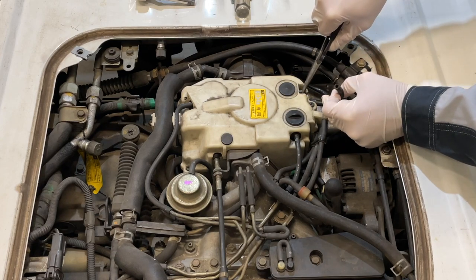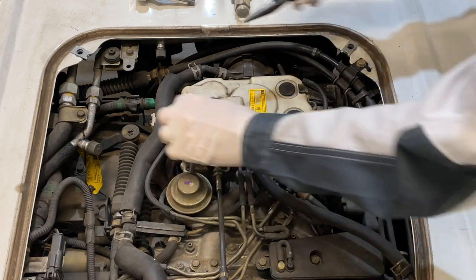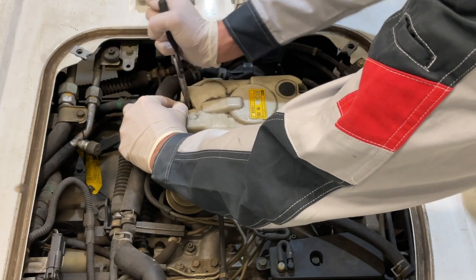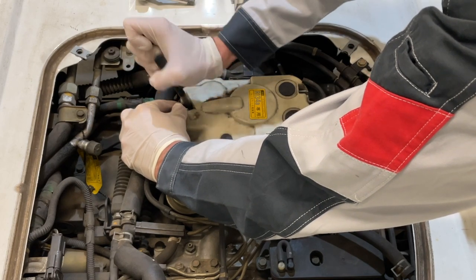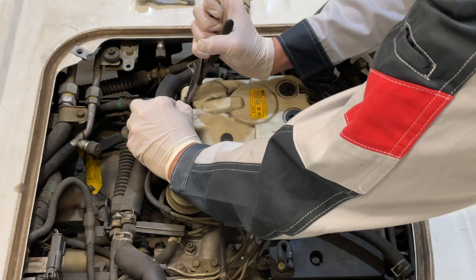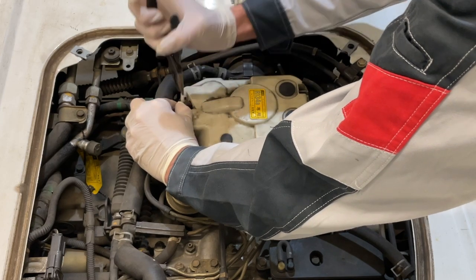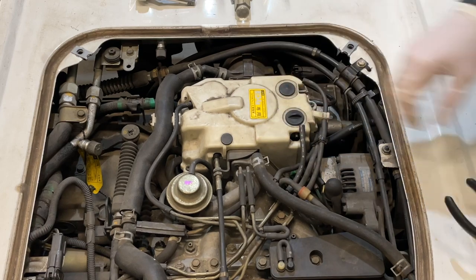This one's metal. It's a good deal. Relatively easy there. And this guy here has given me trouble in the past because the nipple is very deep behind the upper cover. So just be very gentle with that and try not to tear the hose as well. Otherwise, you get into vacuum leaks and idle surging issues and things like that. So I'm gonna go through and get these off, remove these screws, and we'll see what's underneath.